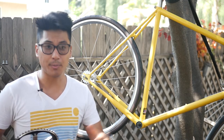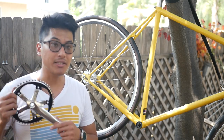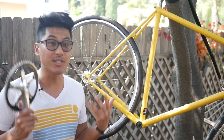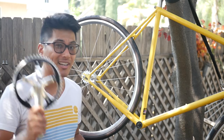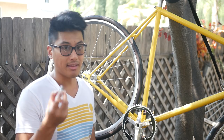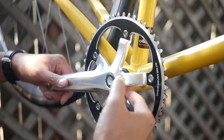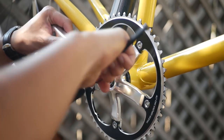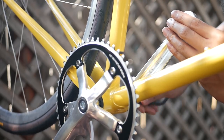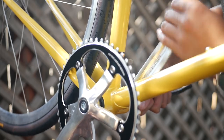Now's the fun part — we've prepped all our components, let's put the bike together. Wabi was nice enough to pre-install the bottom bracket. If you're building your own bike, make sure you have the right bottom bracket for your crankset, because there is a specific bottom bracket that goes with each crankset. Installing the crank is pretty straightforward — just bolt it in. I prepped this with threadlocker so it won't loosen over time. Important: do not grease the spindle of the bottom bracket, because if you do, you can easily over-tighten your crank and damage it. When putting on your second crank, make sure it is parallel and directly opposite from your first crank.